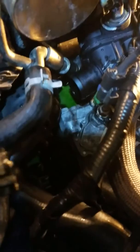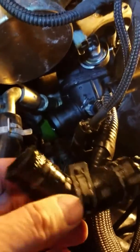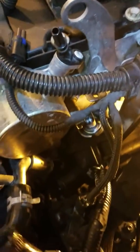When you try to pull it off this way, it doesn't go because it's connected to metal coming down this way. And if you try to take it off this way, it's pushed into the thermostat on this side. So what I did is I pushed down right in the center on the V and just went straight down at once, and it took it off both ends at the same time. Once we had that off, we had accessibility to get the wrench in. We had a 3/8 drive socket, 10mm, right onto the nut. Took it off really no problem.